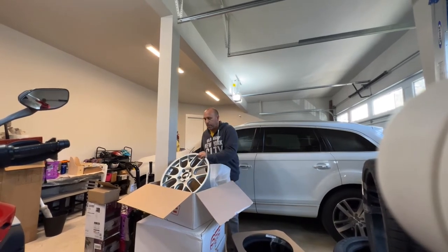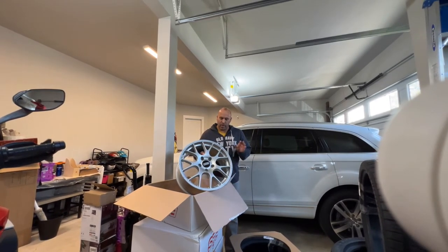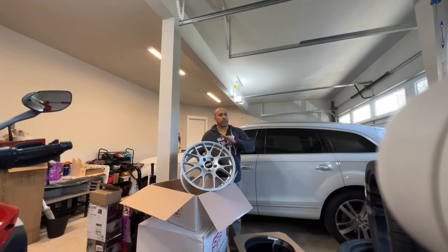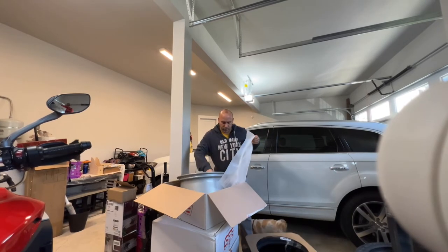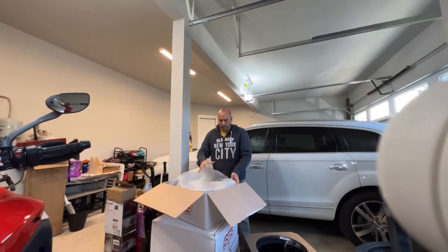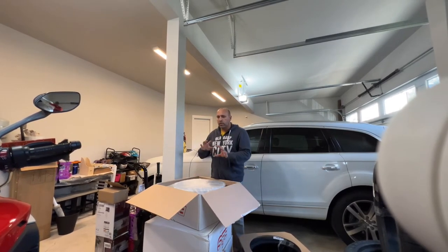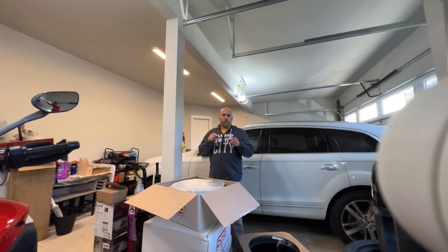This is the front wheel. My OEM wheels are 19 by 8; this is 19 by 8.5. I was happy to get 19 by 8.5 so a 245 can fit on there with no issues. A 245 can also fit a 19 by 8, but having the right size wheel to match the right size tire means it'll look right — no bubbly look, no tire looking too fat. Tire Rack is really good for this: click on the tire size and look at the specs and it'll tell you the width.